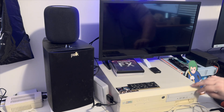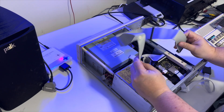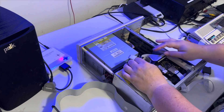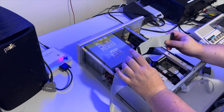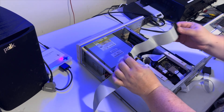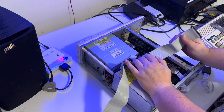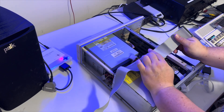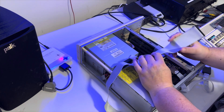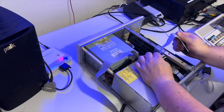You see down here this little DVD drive which is now filling that hole that's been vacant for so long. So you're going to see a really long IDE cable here. This is part of the mystery and the magic. This 4000 had a very small IDE cable, and the issue was I was letting the cable that was easiest to use plug into things where it needed to go. So I wasn't actually using the last cable - I was using the middle one. What was happening was it would go out looking for the other device that should be connected, and it wasn't there - it was just random. It would fire off and go looking for the device, the ribbon wasn't there, and then every now and then it would actually hit the one it was plugged into - the middle ribbon - and it would boot. That's why I'd have to turn the 4000 on and off multiple times because it just wasn't finding the hard drive.